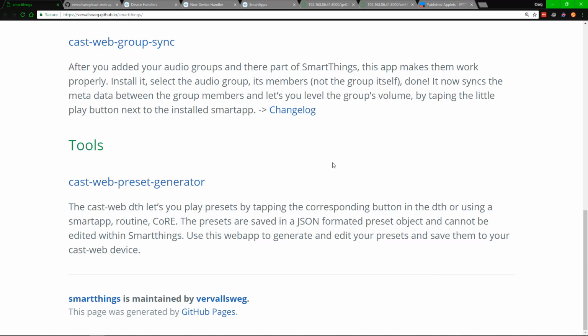With that, I'm not going to set that part up because it's pretty simple to do. But the thing to note is it goes by activity. When the activity starts, which means motion is detected, if motion keeps getting detected, it doesn't keep ringing the doorbell or the Google Home speakers. But when the motion stops and it doesn't see any motion, and then motion happens again, then it rings once again. So if the mail person is doing their thing, you're not going to get 5 or 6 times, you're just going to get that one. So a physical doorbell might still be worthwhile.